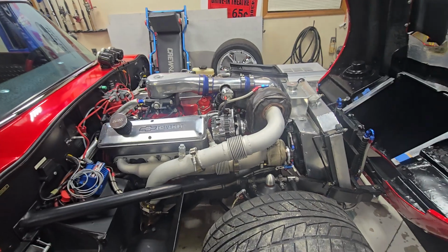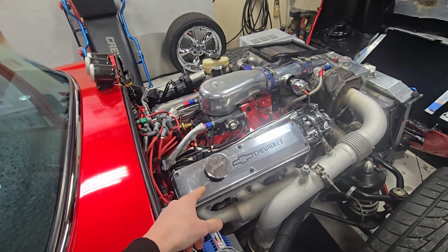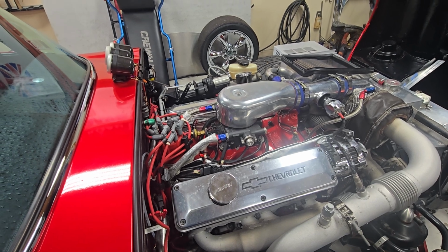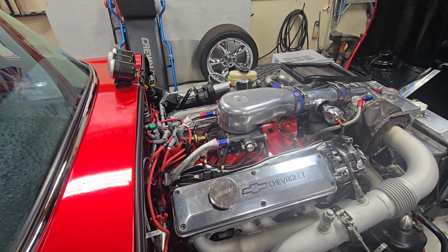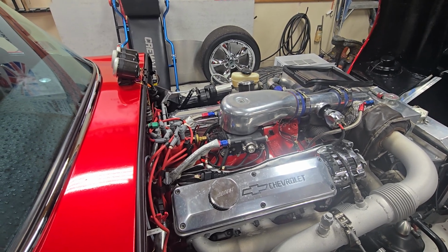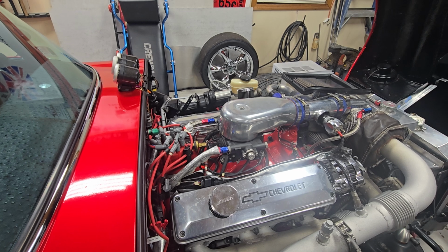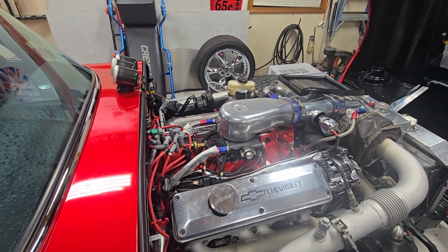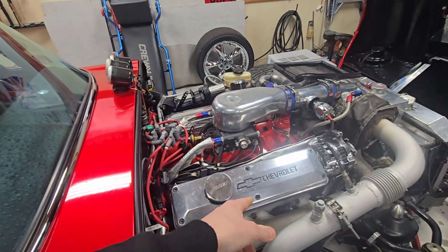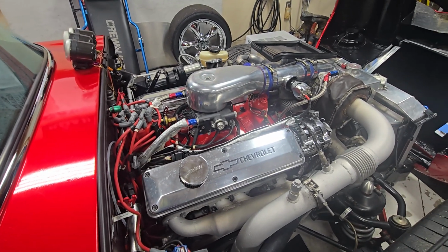Yeah, so tomorrow we'll have a longer form video. So this is just a 350 Chevy 4-bolt main from back in the day. Forged crank, forged rods, forged pistons, 383 stroker. We did that last year during the winter. I think the lift on the cam is like 0.65, and it's a hydraulic roller cam. We had the flat tappet in there. We tore it down. There was actually one piston that was missing some of the skirt and the top piece, so it was time to go.